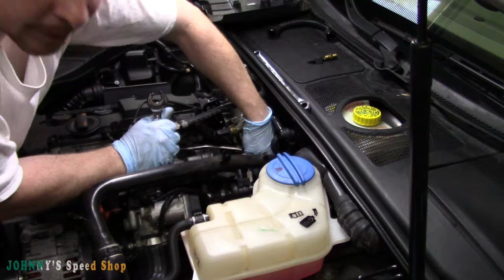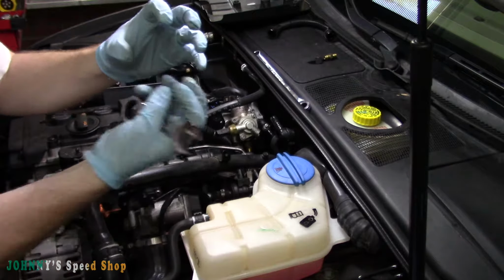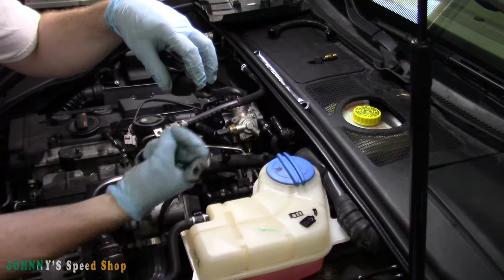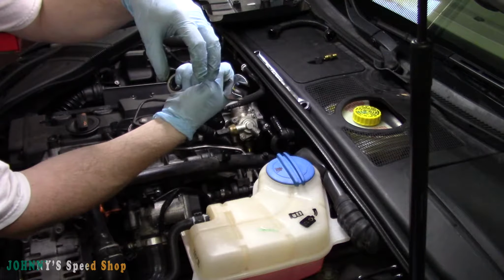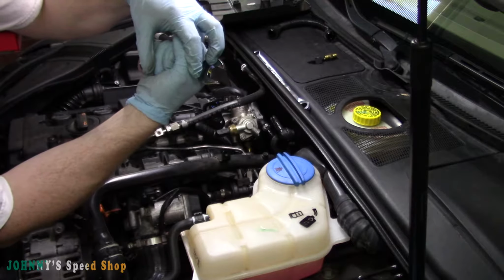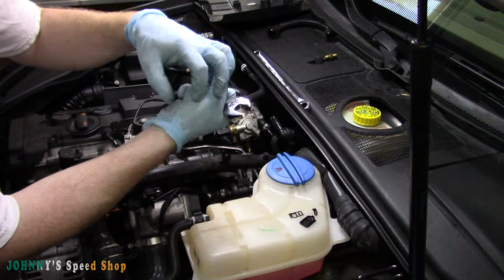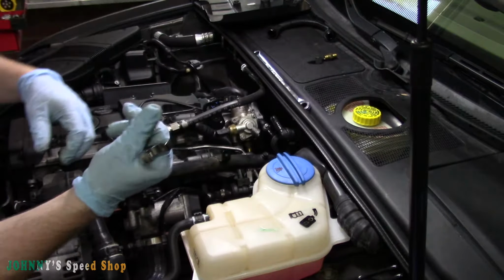And these are on a ball. It's kind of like if you ever towed a trailer, right? There's a ball hitch and a ball. Well, the ball hitch in this case is a fitting on the bottom of the pump, and then the ball is from the line. And a lot of times they'll sit off, and you got to lift them up before you tighten them. If you just try and tighten them like this, you're going to screw stuff up. So you want to lift the line up into place and then run the nut on.